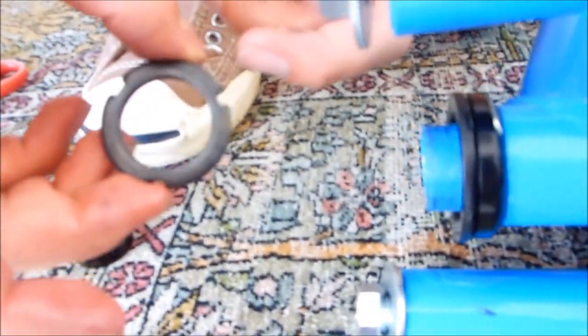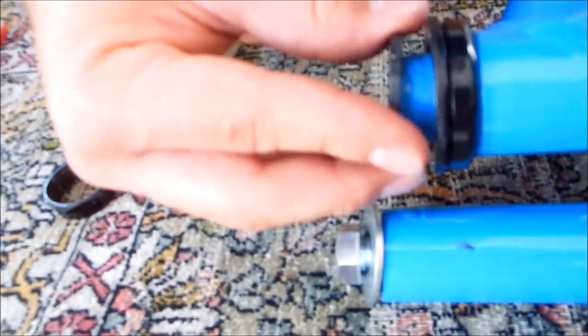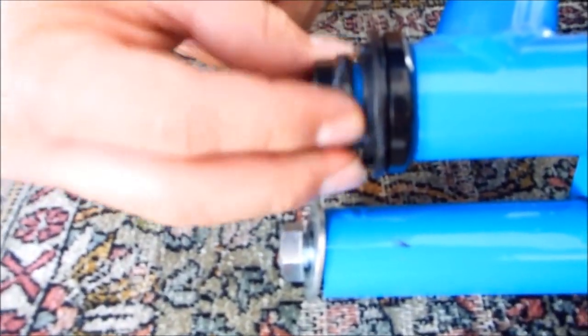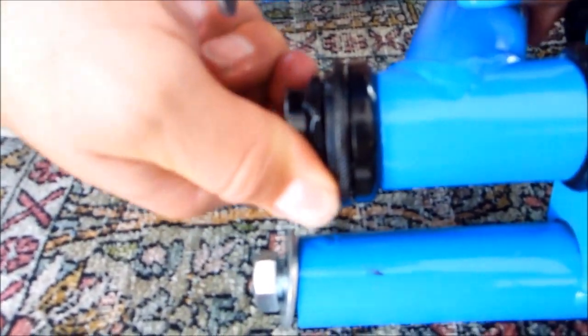Next you put on this ring with the little cutouts. Put the round side facing up. Put that on. Again, you can start spinning it backwards until you feel like a click. And once you feel the click, then you can start spinning it on forward. And there, I was feeling some resistance. Go on until you're not feeling any. Put that on. Last, you put on the nut. Same thing. Spin it backwards, hear a click. Put all the way on. And your tube set is now assembled.